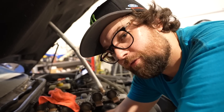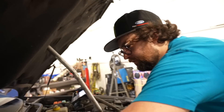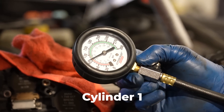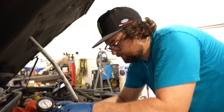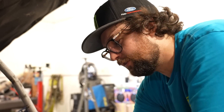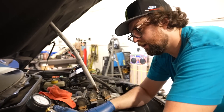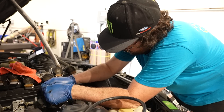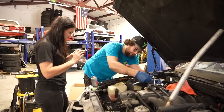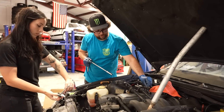All these are within five of each other. These motors typically pull a lot more compression than this, but when we did the SR it was really low too. I wonder if this gauge just reads really low. Typically M3s will read like 200 to 210, but it's even across the board. It's just low across the board - your SR only read 125 but it was 125 in every single cylinder, so I had pretty low concern about that.